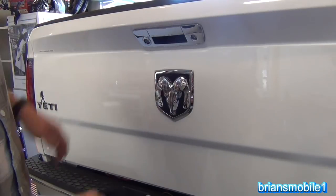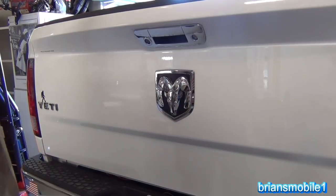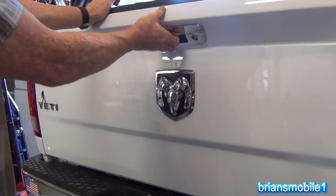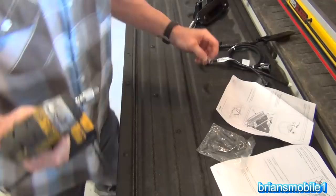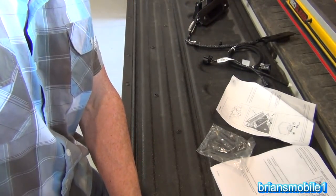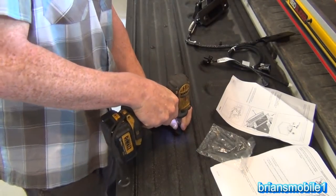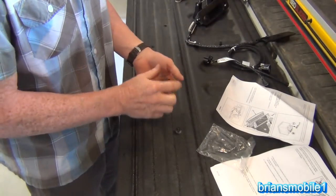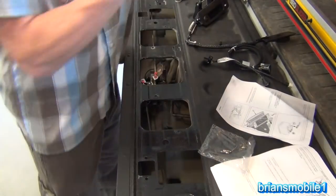Here's my old camera. I've got a little cover on it — two pieces, this one and this one. This is copper; it actually turned out really nice, I've been impressed with it. I'll leave a link in the description for that, as well as some of this camera stuff. First things first: disconnect the negative battery terminal. Grab yourself a Torx bit — this happens to be a T27 — and go around and hit all these bolts. Just spin them and collect them all up. Notice there's a plastic washer with each of them; make sure you take those and gather them. You'll need them. Then just pull off the cover.